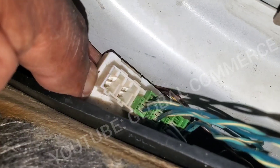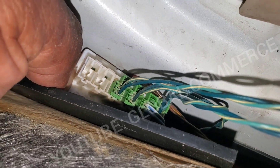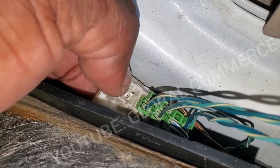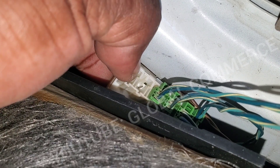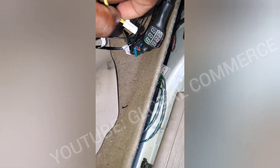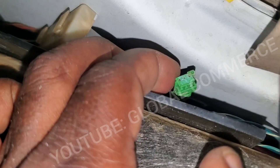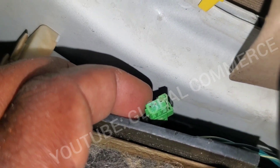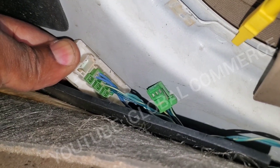Yeah, if you see that — that definitely looks like possible corrosion or discoloration on the wires. The ultimate CAN bus tester has a star connector plug for Dodge, and this actually looks like a similar connector. I'm going to test it and see if it works — if it does, I should be able to get connection into the CAN bus network from the drivetrain line. Here is the connector, and I have some readouts right now. It is compatible — we should be able to get a connection. The connector is a little different so it wouldn't fit fully, but you can see the green crust right there — water corrosion. So that's what we've got going on here. I'm going to go ahead and try to clean all these up and see if we get a difference.